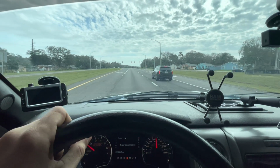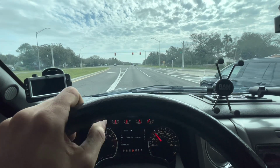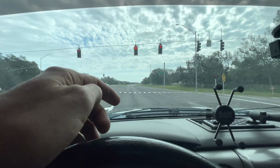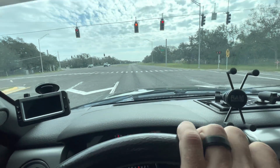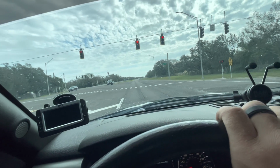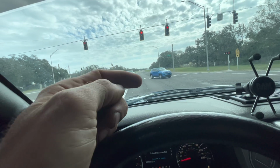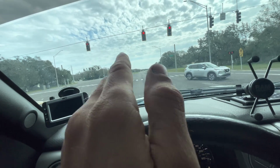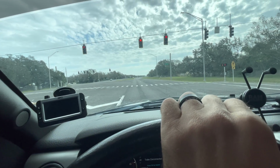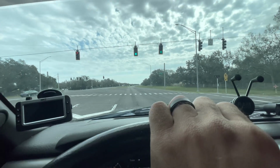Well, so far so good. All I hear is the tire sound. I do not hear differential or gear noise, and that's awesome. I was a little nervous about that because it did take me 8 times to set up that front differential. It was just not cooperating. I could not get the gear pattern to look good, and it wasn't just the one gear. I had to set pinion depth a couple times, and then I had to adjust the position of the differential to get the proper pattern. It was rough. I had a hard time. Not fun. Green light.